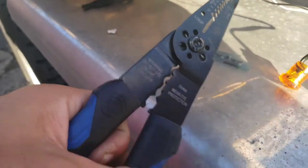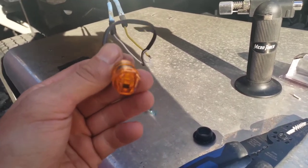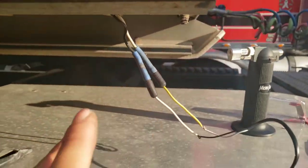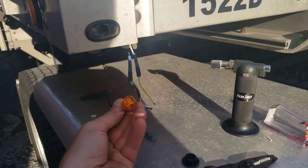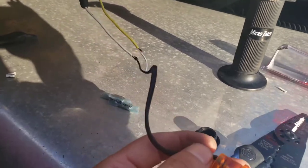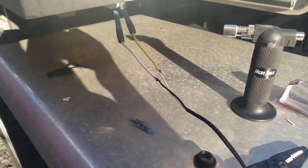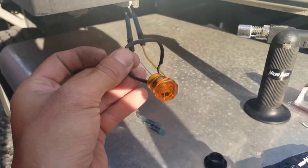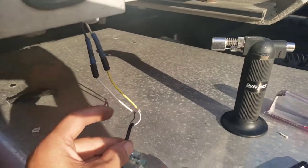We got our butt connectors, our torch, and the crimping tool to crimp the butt connectors. But hold on — before we put them on there, we've got to put the light in the grommet and through the hole in there. Put the wires through there and they'll end up underneath here somewhere, because if I were to butt connect or solder it, how the hell is it gonna go back through that hole? Thank god I didn't mess up this time — but honestly I have before. Don't forget: put the light through the grommet and put the butt connectors on underneath the trailer after you put the wires through.